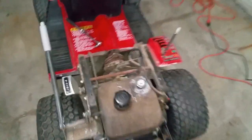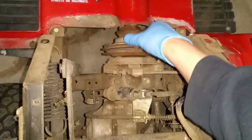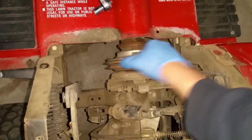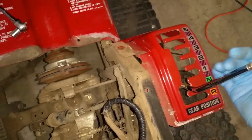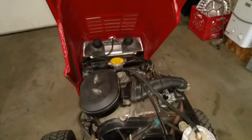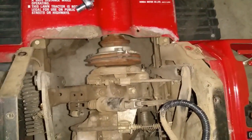Already when removing the rear end, I can tell there's definitely a damper problem. Here's your clutch for the transmission and all your linkage. If you listen, you can hear it — that's the rubber damper, and it's got a lot of play. I have this in neutral, but if I put it in gear, there's the same amount of play, and the engine is not spinning when I do that. I'm not putting a lot of pressure at all — that's definitely telling me we have a front damper problem.